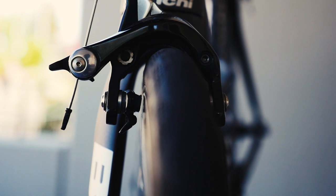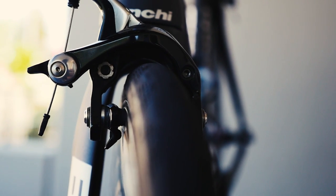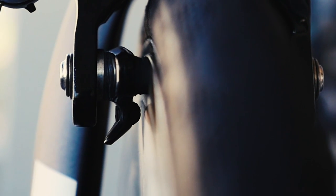Just going to change the carbon brake pads on my Bianchi because they're getting a little bit worn now. If they get too worn, you can really damage the rim. You can see how worn the brake pads are — when we close the calipers, the screw at the bottom is just about touching the rim, and if that starts to touch the rim it'll wear through.